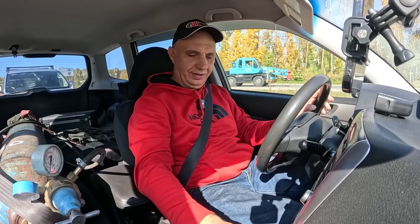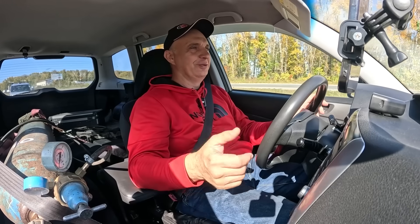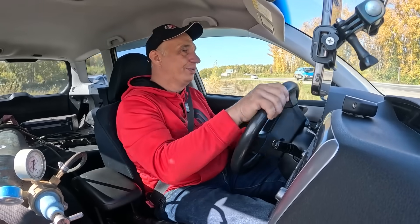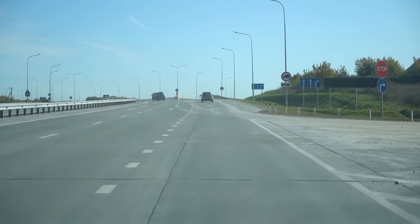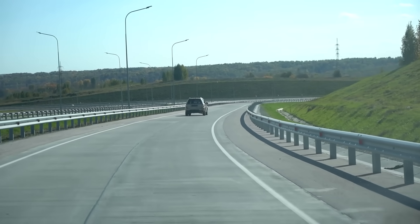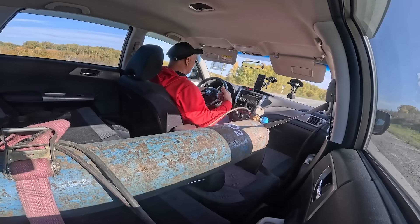We've timed the acceleration — that's all good and well. But we also need to just drive around. The engine is starting to not feel too good, for whatever reason. But I mean, the reason is fairly obvious. After all, oxygen is an oxidant. Metal is only going to rust when it's exposed to oxygen — once it is, it turns into oxide. And when we add fuel, the mixture is going to be lean. Fuel is lacking but there's a lot of oxygen. Combustion is clean, but you're dealing with extremely high temperatures. Driving around on a lean mixture is very dangerous, because you can melt the pistons, scorch the valves, if your engine wasn't designed with such a mixture in mind. And in this case, I think we might be experiencing an issue.